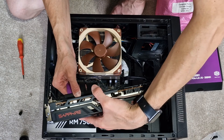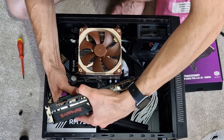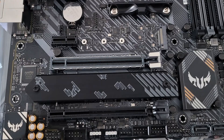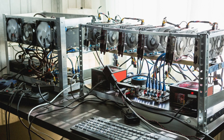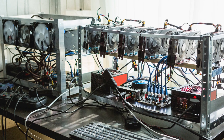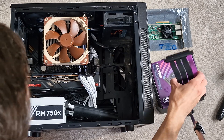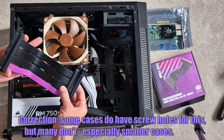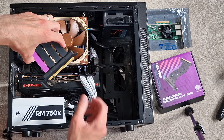In this case, the second thing you can try is riser cables. You can plug one of these into your graphics card and then move it somewhere else in your case. This is what tech creators use who vertically mount their GPUs — they relocate the GPU away from the traditional top slot. Riser cables are also what crypto miners use so they can have loads of different graphics cards in their rig. There are three things you really need to know about them. Firstly, unless you buy a full kit, a simple riser cable won't give you anywhere in your case to mount your GPU — it'll just be dangling around, which could lead to damage.